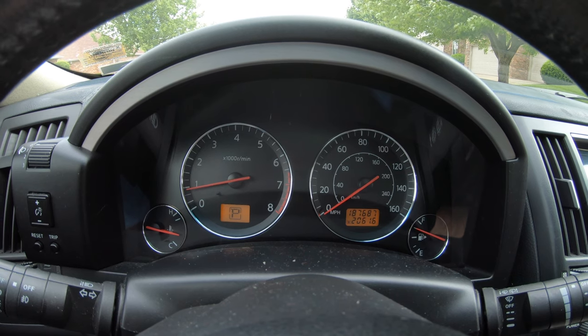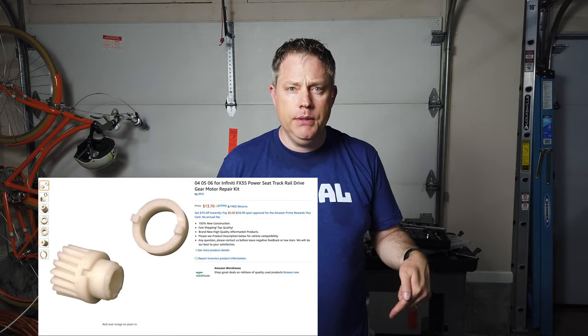So important instruction — I'm glad I caught this before I published the video. I fixed the seat forward and back movement for I think a $13 part. I will leave a link below. I think you can do this project in about an hour or an hour and a half. I used a 9/16 or 14 millimeter socket, and it would be helpful to have an end wrench in case the seat is stuck. A Phillips screwdriver. A 10 millimeter socket or nut driver for the gear, and then some way to grab the gear — I used a thin vice grip — so you can twist and remove the nut that holds the gear on. Next time I'm going to work on the driver's seat where the front and rear lift motors aren't working. Hopefully the gears I have work for that. Stay tuned because I've got the big stereo install project coming. Check out the other videos in this series. Thanks so much for watching guys, I appreciate it. See you next time.